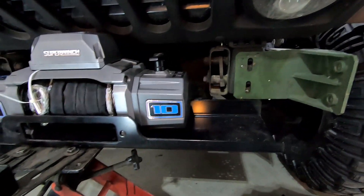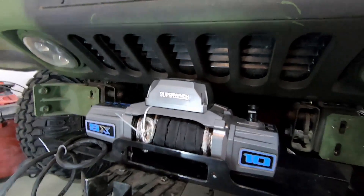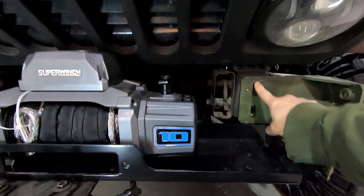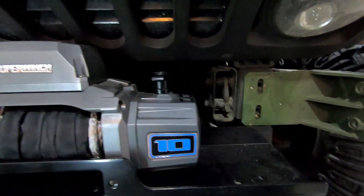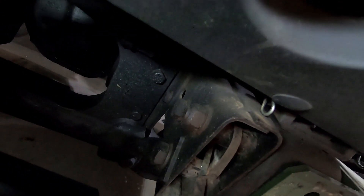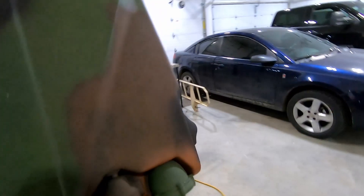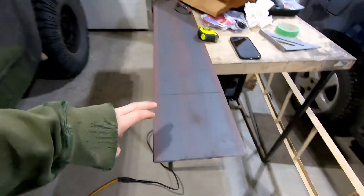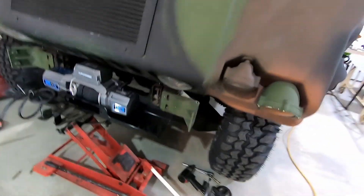This is not going to be perfect by any means, but we're going to make it functional. The hood is up at its maximum tilt right now, and my bracket is falling right underneath the mounting bracket where the hooks go. I really can't attach much further back because there's a strap to the front suspension in the way. That holds the front crossmember in place for torsional push. So what I'm going to do is go over and cut some 8-inch by 8-inch plate and build a box off of here.